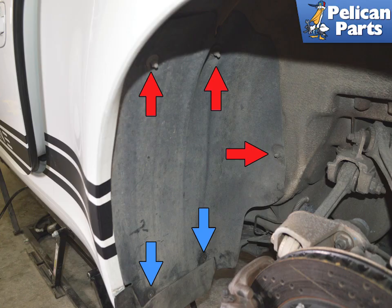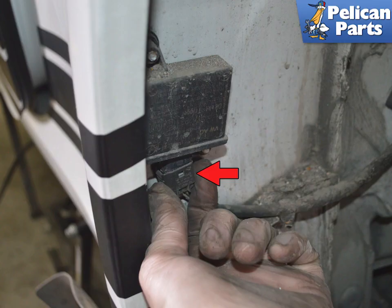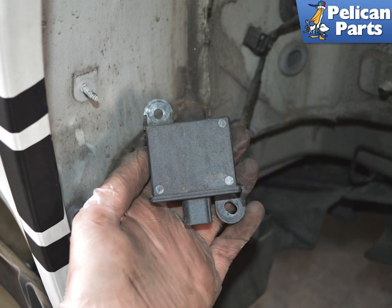For the rear wheels, you only need to remove the section closer to the vehicle's front. Please follow the link provided at the end of this video if you need additional assistance. Each liner is held in by a set of T20 Torx screws and three 10mm nuts. Remove them, then remove the liner. Locate the rear antenna. To disconnect the electrical connector, press in the release tabs. Use a 10mm socket to unscrew the two nuts holding the antenna, then remove the antenna from the chassis. The process is the same for both sides of the vehicle.